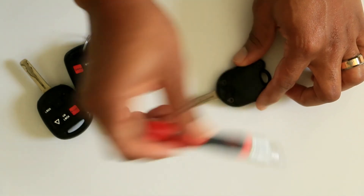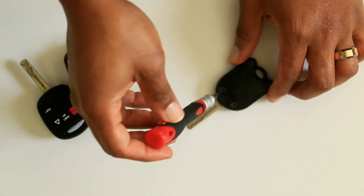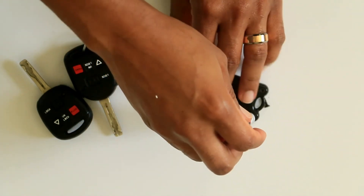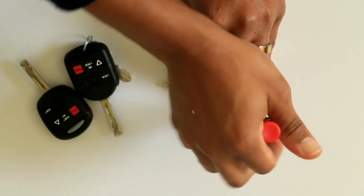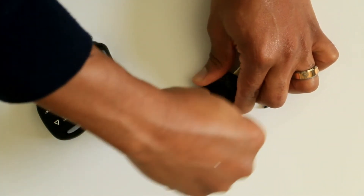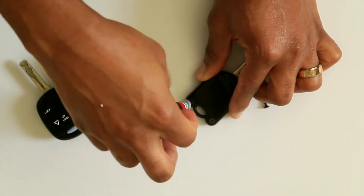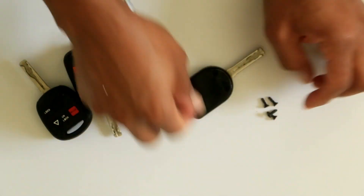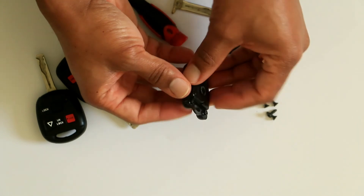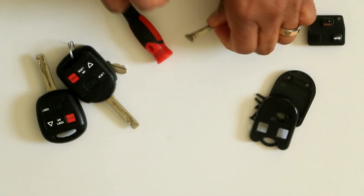So what I'm going to do is just take this apart. You're going to need a T8 — T as in Tom — number eight Torx screwdriver. It actually comes with one, but I prefer this one. The one it comes with is like an Allen key. So I'm just going to loosen all these up here so there's not any extra pressure on one particular side. And then you just pull it apart, and that's kind of it. It comes with all this stuff in the bag with the screws and your Allen key.